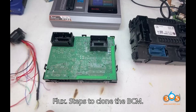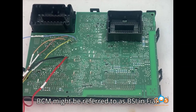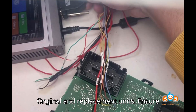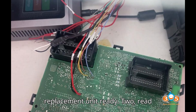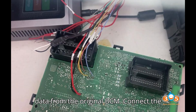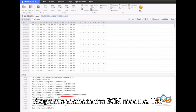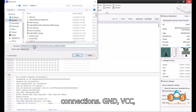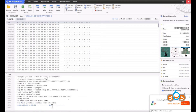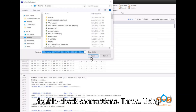Steps to clone the BCM. Step 1: Preparation. Identify the BCM — for a Jeep Renegade, the BCM might be referred to as BSI in Fiat. Ensure you have the original (bad) unit and a replacement unit ready. Step 2: Read data from the original BCM. Connect the BCM to the Multiprog, following the wiring diagram specific to the BCM module. Use the MCU adapter and carefully solder the connections — GND, VCC, brown and orange wires. Ensure you add flux for better soldering and double-check all connections.